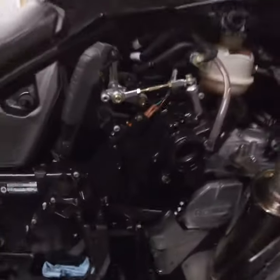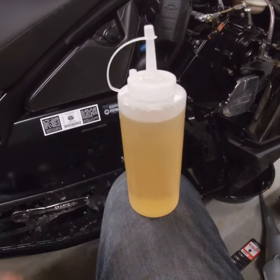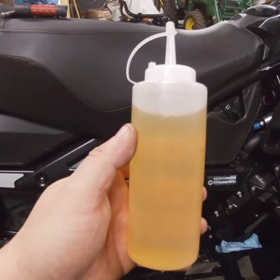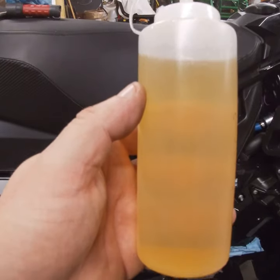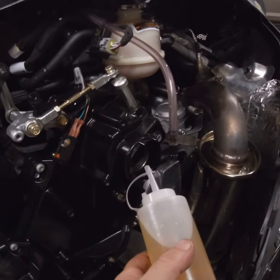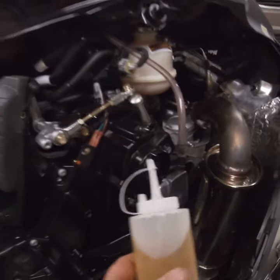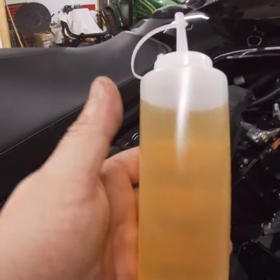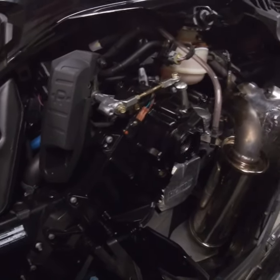You might be wondering what this is — it's a mustard or ketchup dispenser, and this is actually a little hack to make this job a lot easier. It's got a nice small fill nozzle so you can just dump your chain case fluid in here, then tip it right into that gap and start squeezing while you watch the sight mark. This makes the job a lot easier than using a small funnel, because funnels just rattle loose and you'd have to do two things at once. With this you can do it one-handed and watch the fill at the same time.